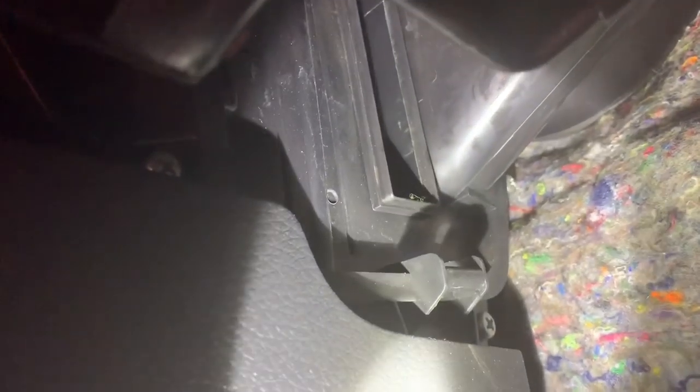The way you replace it on majority of these Nissans — I used to work at a dealership — a lot of these cars have the filter right here on the passenger side. This is a piece you will have to clip off on these Altimas, and you have to pretty much get upside down, or you can get it from just being on your knees on the passenger side. Some cars have it straight up, but on this particular one it's right here to the left. You see that hole? That's where the cabin air filter for these Nissan SRs is — it can be confusing because usually it goes straight up, but it's on the side on these.